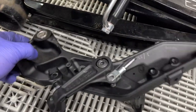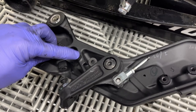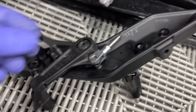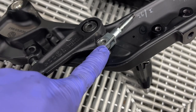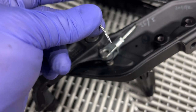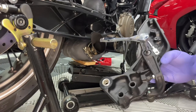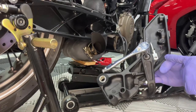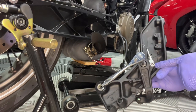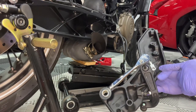Once you get the right side set off, there's one more 10mm to remove — it used to go right here. There's also a cotter pin to remove for this rod. Just bend the cotter pin and pull it out, then you'll be able to remove the rod. This next part is a bit of a pain — you also have to remove a cotter pin from the rear set itself. Pretty easy — just bend it and remove it like any other cotter pin.